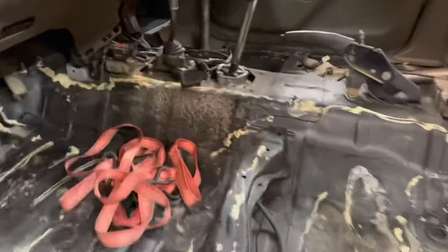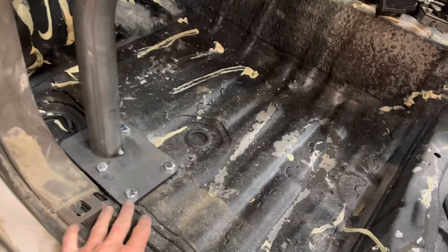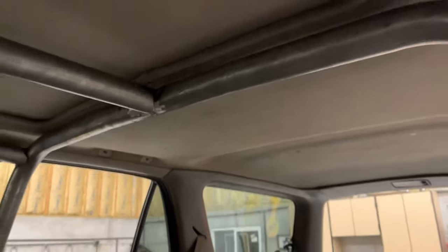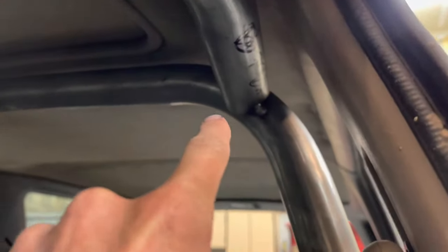It's been a couple days since we've been out here in the shop. Me and Casey got the A-pillar plates mounted and the A-pillar tubes coming up into the B pillar. On the B pillar, it was sent to me in two pieces with a sleeve — you drill two holes on each side, slide the sleeve in, and plug weld them. Then you fit the B pillar, make sure you like the distance side to side, tack it, and weld it. The B pillar is fully welded, and the A pillar is tacked to it on each side.